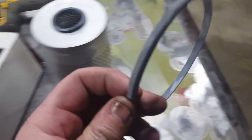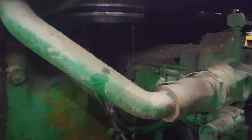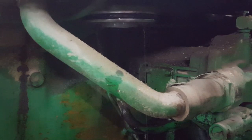It goes right into that groove right there. We haven't picked the old one out yet, but it's a good idea to change it. Another thing: grease it up some, and that'll make the can come off a lot easier next time. If you put this rubber in there dry, somehow the can and it just bond together and make that can a real bear to pull off when you go to change oil.